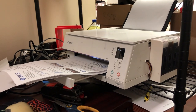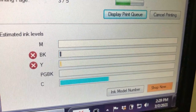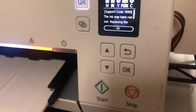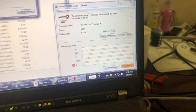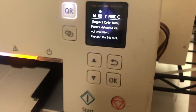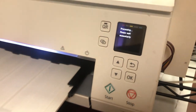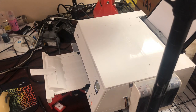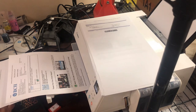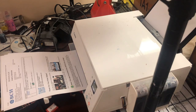After that, close the cover and start printing. You cannot turn off the chip at any time — you have to keep printing until you get an error. It gives OK as an option, so press OK. Then the cyan will have a red cross next to it. Keep printing until you get a second error. This one doesn't have an OK option, so press and hold the orange triangle until it disappears and it goes back to printing. After the second error, press the OK button, and then the ink level will be grayed out and the printer no longer tracks ink level. You have to keep an eye on the big tank — whenever the ink is low, just add more ink.